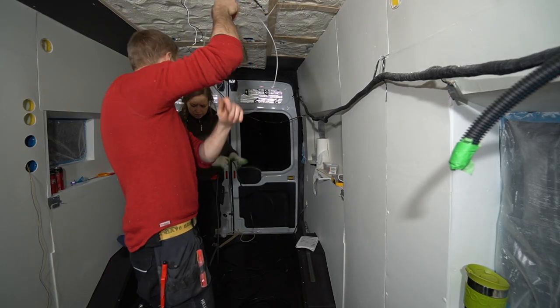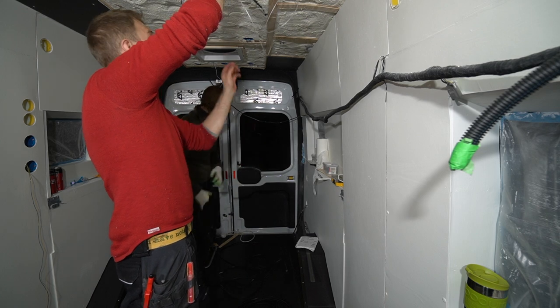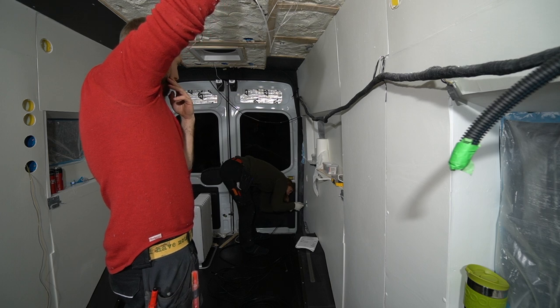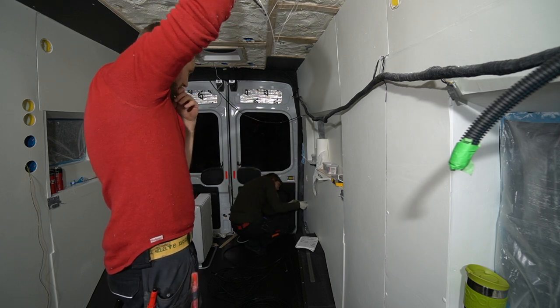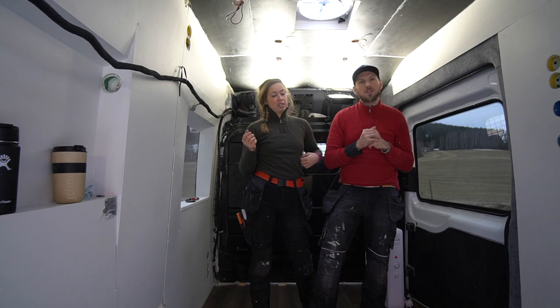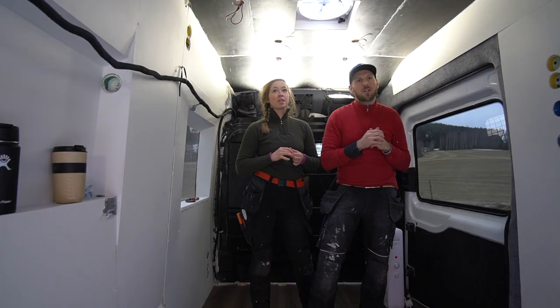And the wiring was a little bit more tedious than we'd imagined. Because, as you know, we had prepped the conduit before, so we actually just had to pull the wires. Apparently some of the conduit just travels around the car for meters and meters. We hadn't really thought about length being an issue for the current as well, so we have to dimension the wires with that in mind. But for most of it we could use the conduit that we had done, and for some parts we had to do some new rerouting.